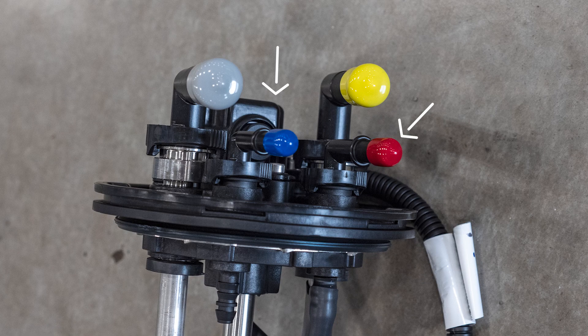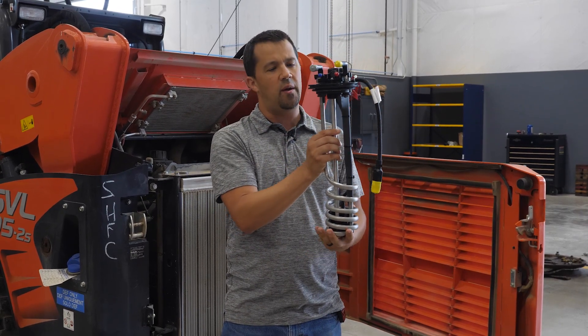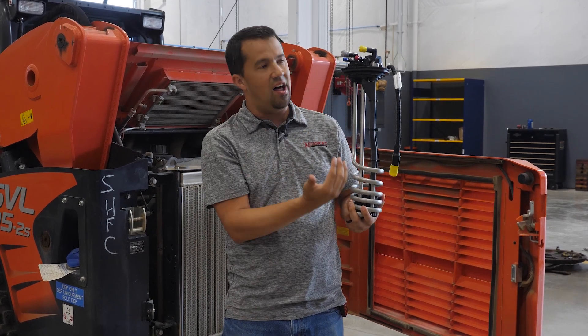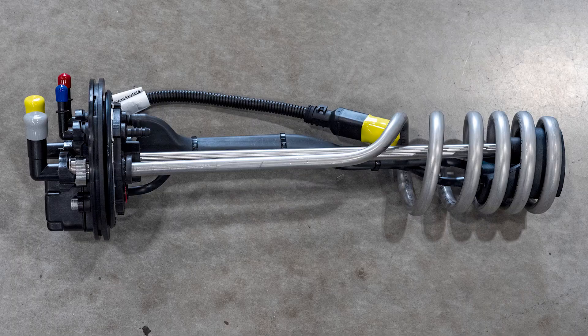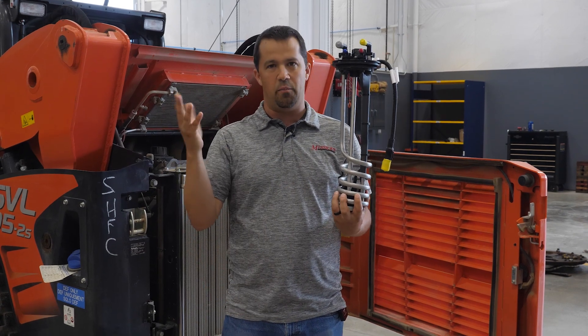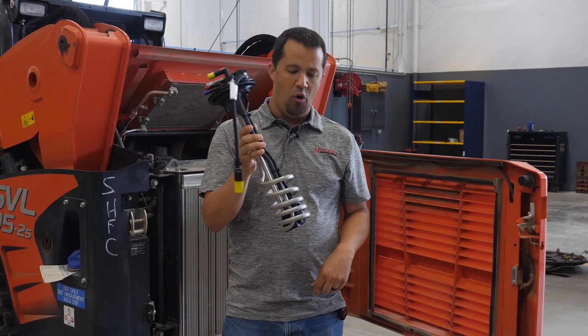The other lines here are going to dip down into the tank itself. There's one line right here that comes up to the quality sensor that we'll talk about later. A vent line here at the top, and then an intake line to pull the DEF up and out into your exhaust system. This plug here at the top is for the quality sensor — that's this box that sits on top of the assembly right here. It measures that the DEF has the right proportions of the different agents and water inside of it that help it work properly.